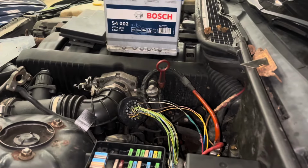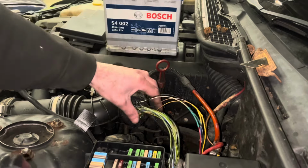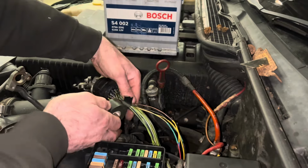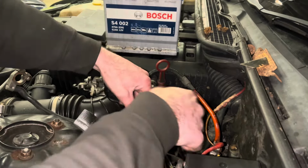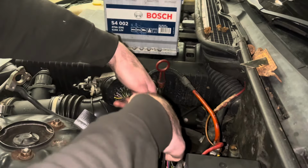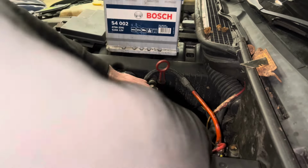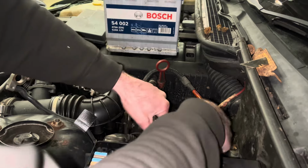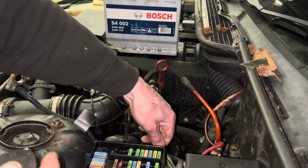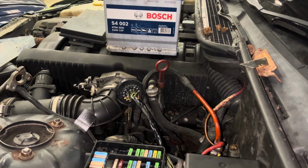So that's me soldered and heat shrunk the 4 wires that I've connected. I'm just going to give this a quick tape up so it's not too messy. I took some tape off to actually access these wires so I could get a good length for the wires. Either that, you've got to cut them up there, which is no good to anybody. And they shouldn't just be coming in here and twisting wires together, so I'd rather you solder them and use heat shrink than anything else.